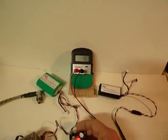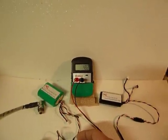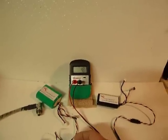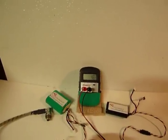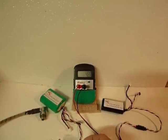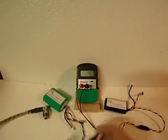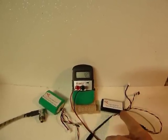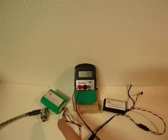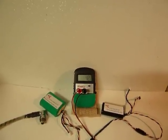After this video is over I'll recharge this battery and post in the video data how much was actually out of it percentage-wise. We're showing 6.5 volts — occasionally it bobbled up to 6.51, but I tried to get as close to 6.5 as I could. If you're flying your A123 in your airplane, whether on ignition or anything else, by the time you get to 6.5 volts you've used a good load out of that battery. Two diodes, ignition reducer — low battery reasonable voltage, high battery reasonable voltage, safer ignition. That's my opinion.